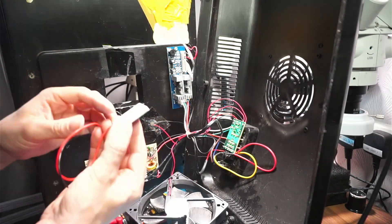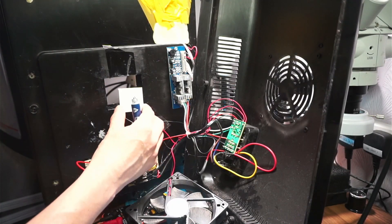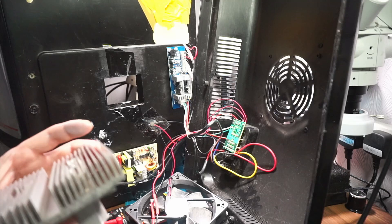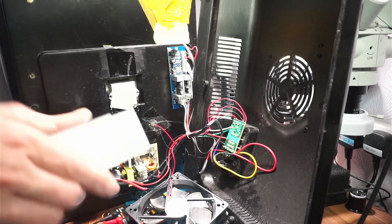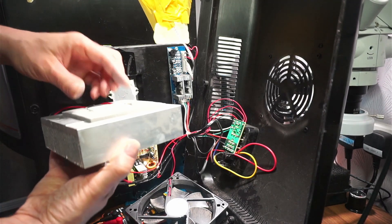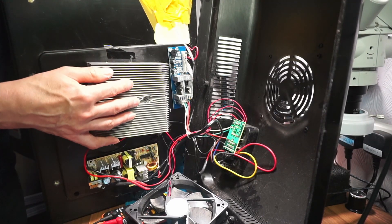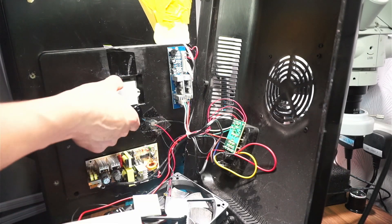So that should be it — just a matter of putting this back together. I'll put some new MX4 on. I can't remember if the writing faced out or faced in, so I'm going to have to check how Simon did it. The original one was text facing out, so we'll do that. I'll put a bit of thermal paste on there, just to hold it, and try to get the other heatsink on without that moving — which is easier said than done. That wants to go on like that. I've got no way of screwing that in without the other side moving.